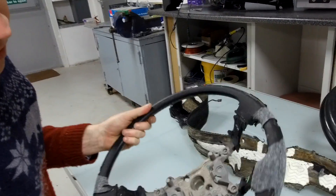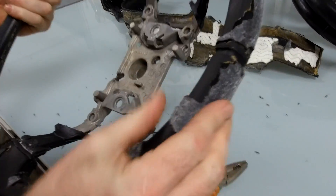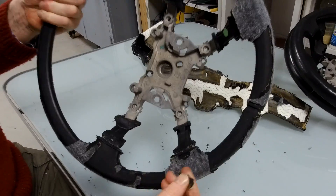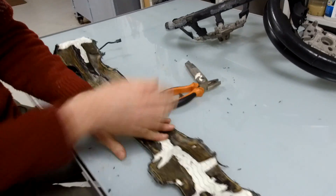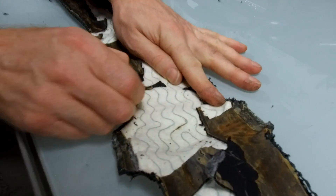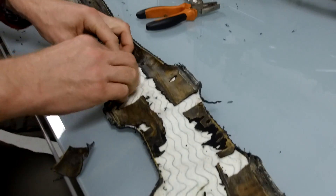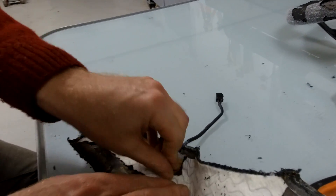So there's the steering wheel - it's still got a rubbery layer on it, so that's polyurethane rubber, and you can see that's where the adhesive was. You've just got some of the inner skin of the heating pad left on there. That's the stripped-down steering wheel, and this is sort of like a dried-out snake skin you get left with. You can see the wires going through underneath here - that wire is the heating element embedded in the leather. Obviously it goes all the way around, top to bottom.